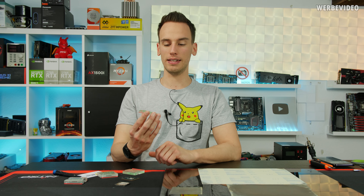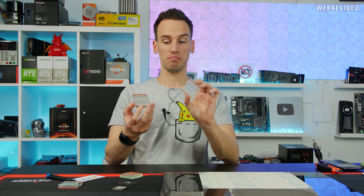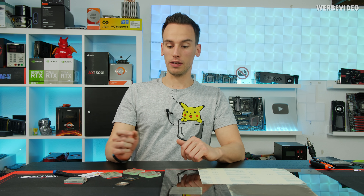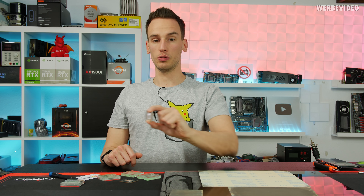The same manufacturer of the Encore now made the Enlab IHS and also the Enlab Die. Both acrylic tools are made for perfect sanding or lapping of the IHS and CPU die. Once the 9900K was released I already published a video showing that the 9900K had a higher die than the previous 8700K, therefore the thermal solution was a little bit worse. Silicon has a worse thermal conductivity than copper — if you increase the silicon thickness you also decrease the thermal conductivity. We saw slightly worse temperatures with the 9900K than with the 8700K even though they were using STIM, a soldered thermal interface material which connects the heat spreader to the CPU.